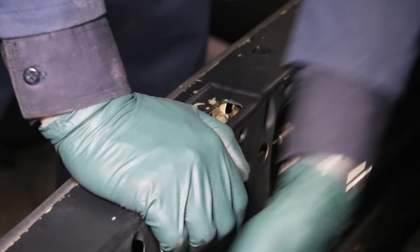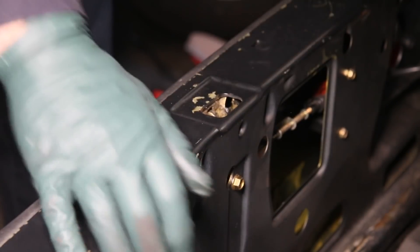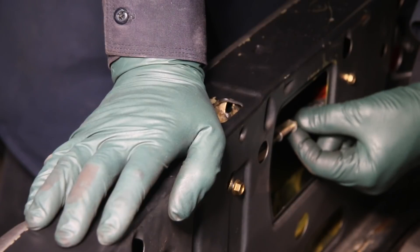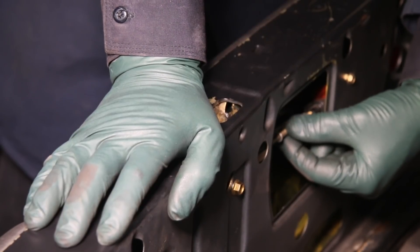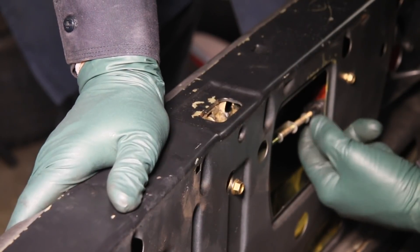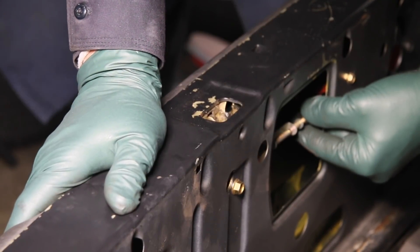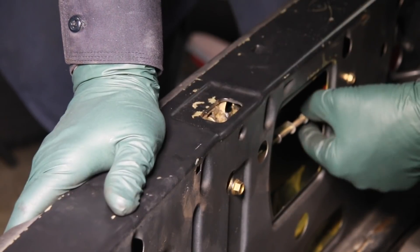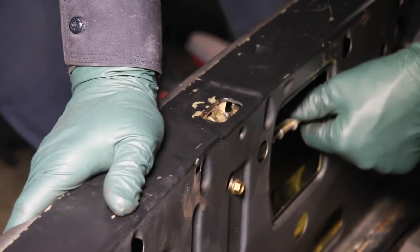You'll have to remove this panel here in the back of the trunk. I pop this plastic piece off and remove this panel, which exposes the vacuum trunk lock actuator. If you look closely, there are some springs there. This is spring loaded to always lock, not spring loaded to stay open. I'll grab hold of the plastic part of the actuator — look what happens when I try to push it to the open position. See how it springs right back to the lock position. I need to figure out how to get this so it just stays in the unlocked position.